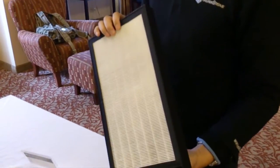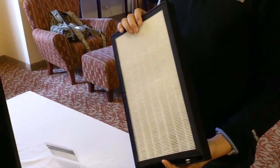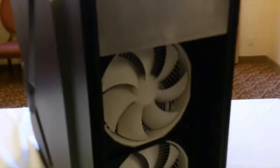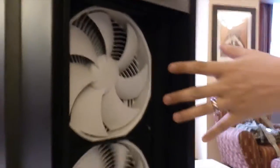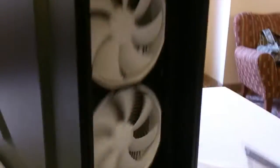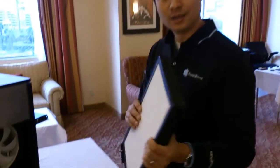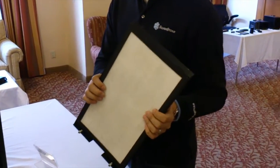This is usually the filter you see in cars, air conditioning units, or air purifiers. In computer cases, normally you don't have fans strong enough to overcome a very highly resistant filter like the HEPA filter. So these two are AP182 fans — they have a maximum CFM of over 150 each, so they're able to overcome a very highly resistant HEPA filter like this.